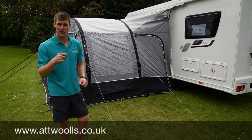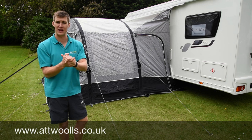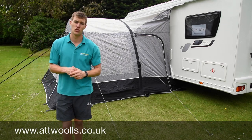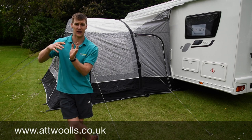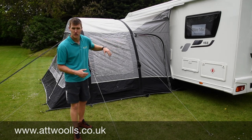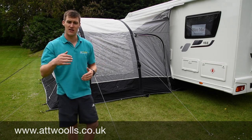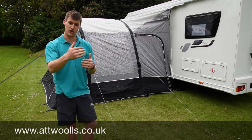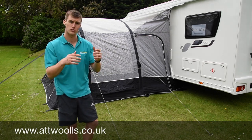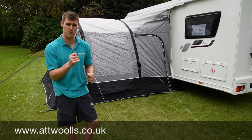The joys with driveways is that normally there are three different fitting height levels. Depending on the size of your vehicle depends on what sort of driveway awning you can go for. For the Vango range of driveways, they have a low, standard, and tall. The main body of the actual driveway awning is exactly the same — what changes is the connection part. Low is designed for vehicles from about 180 up to 205cm, standard goes from about 205 up to 235cm, and tall — which is the model I've got here — goes from 235 up to about 285–295cm. Different companies and awnings have their own height variance, so double-check that before you buy.